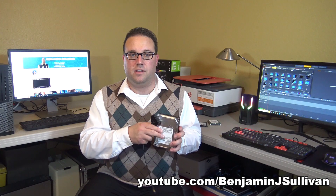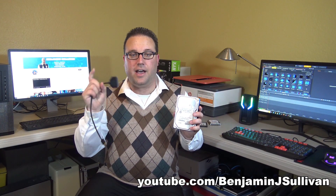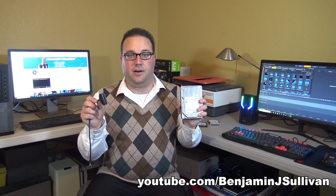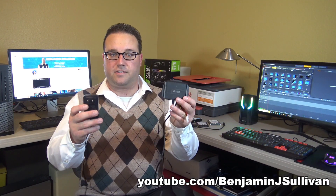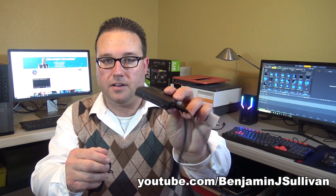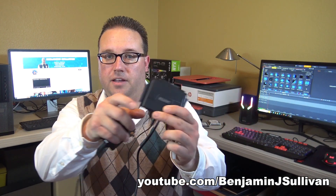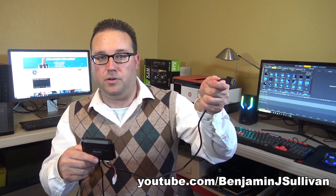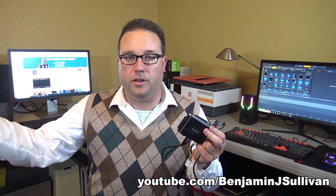So you're probably wondering, how do I fix that? Using this basic adapter, you can't. However, there are other adapters that require an outlet that do work, and I'm going to show that to you right now. Notice I have this kind of adapter — it does have SATA connectors on one end, and then there's a cable that plugs into a USB port on the computer, plus a power adapter that plugs into an outlet or power strip. That will give your hard drive enough power for the computer to access it through USB. Let's go ahead and test it out.